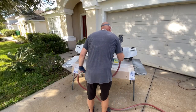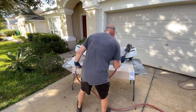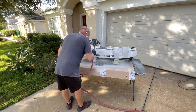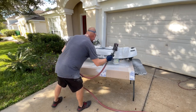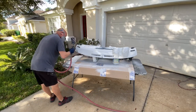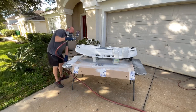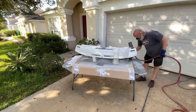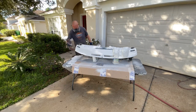If this was going to be a gloss finish, I would most likely do another guide coat after my second coat of primer. Here I'm shooting the second coat — the same stuff, the FP401. It's a 2K high build primer; it's the only one Finish One makes, I believe, and it's the FP411 for the hardener. It's a four-to-one ratio — pretty straightforward. I like to do two nice coats of it. The only problem with this is that there's no way to thin it out, so there's no reducer in it. Like my epoxy primer, I can thin it out if I want and spray it glass smooth — with this, there's just no way to do that. You get what you get.